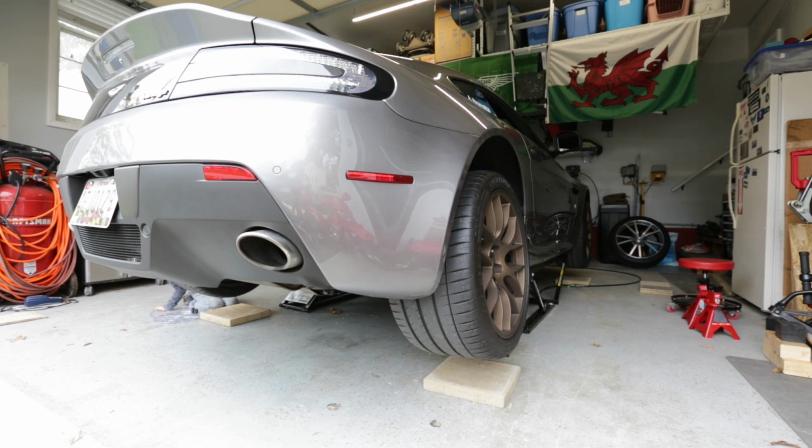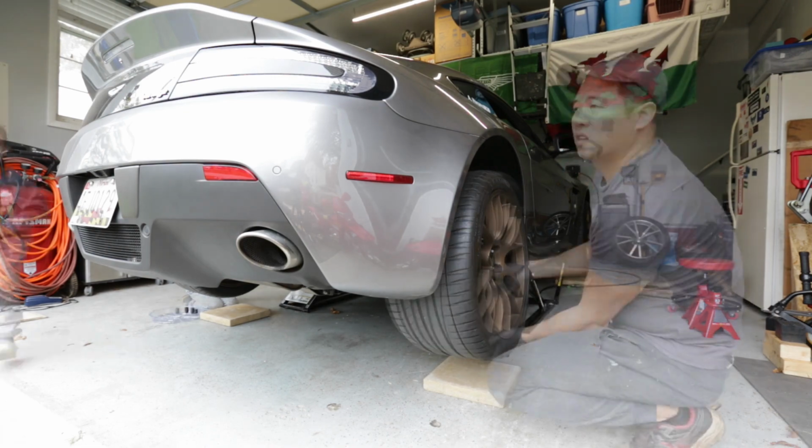It's a 21 millimeter lug, and a tip here before, because we potentially have to get the rear under tray off, I'm not sure. But there is a 13 millimeter bolt that is right near the rear jacking pad. If you take the rear jacking pad up, it will cover that bolt and it'll make life hard. So I went ahead and undid that 13 millimeters, and we should have access to it once we get the car up on the jacks. So let's go ahead.